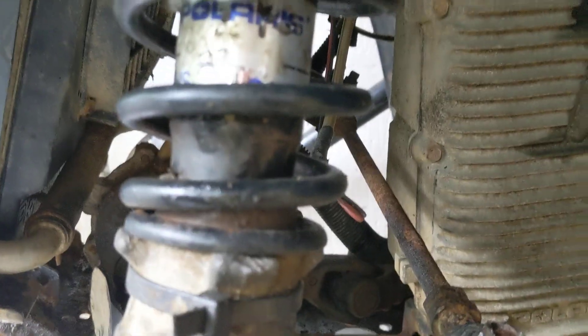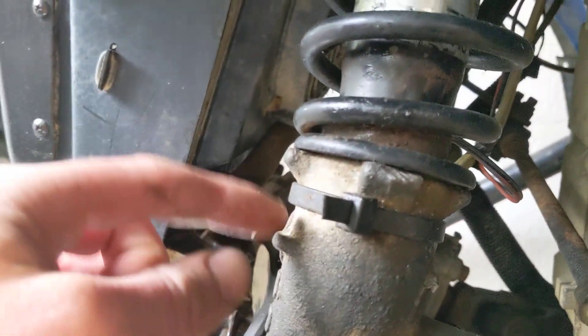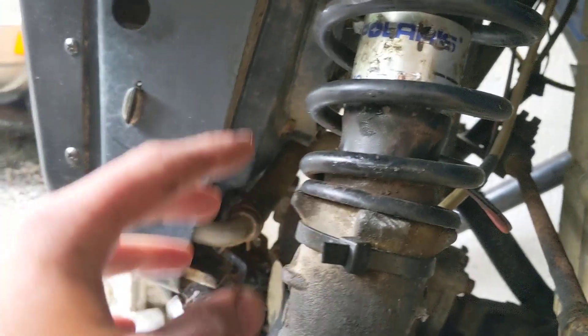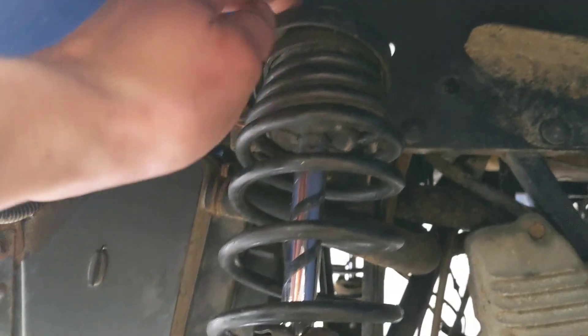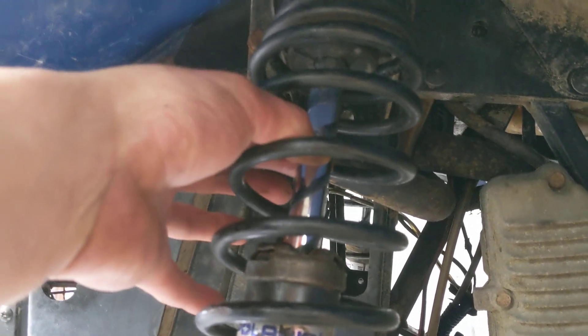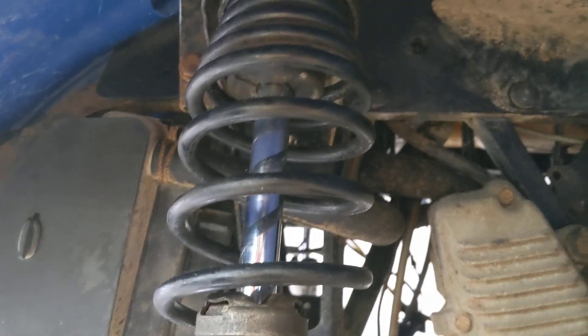The spring was snapped, which I think I showed you on the initial inspection. That was a bit of a pain to change, primarily because normally I would suggest just taking the shock out, but the shock was so seized in I couldn't get it out. So I had to undo the nut at the top, drop the whole strut down, and then there's another nut in there that retains the springs - I had to hold that with vice grips to undo it. But the spring's on there now and it handles a lot better for it.